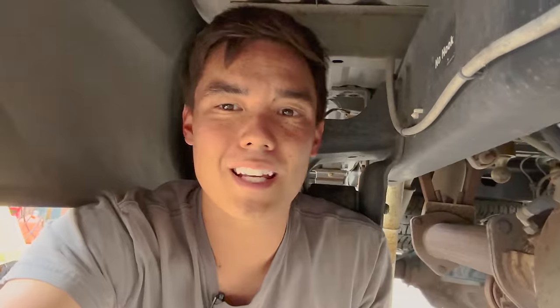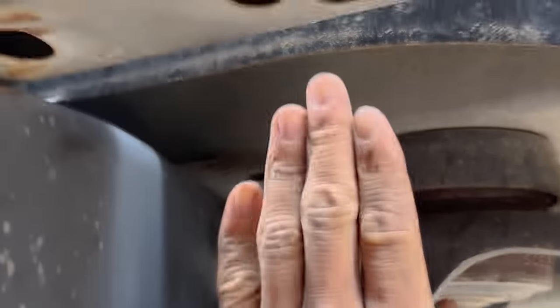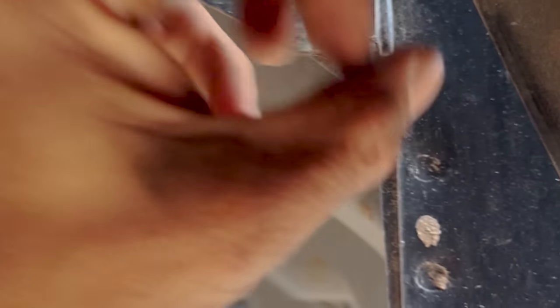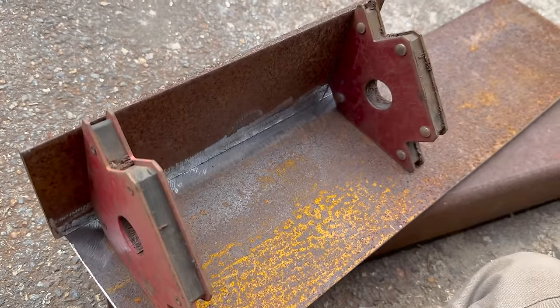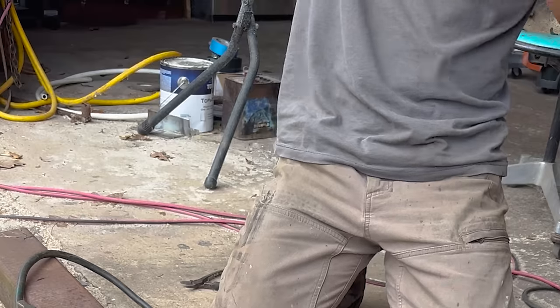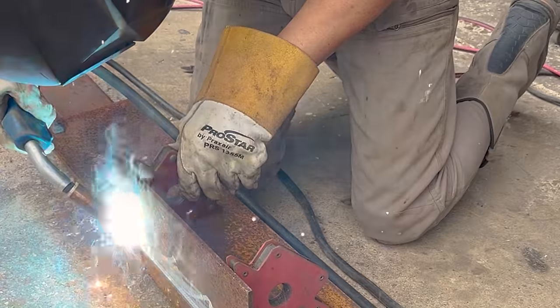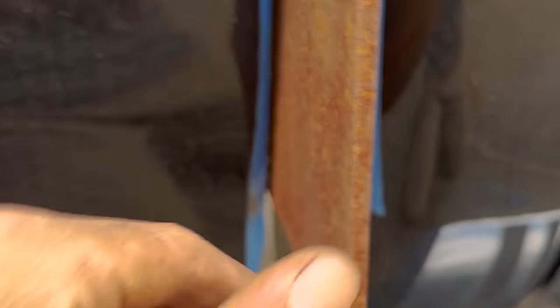Now we're under the truck because the next thing I need to build is tie-downs to hold the camper in the truck, and I'm too cheap to spend like a thousand dollars, so I'm going to build my own. Got some plates — I have a plate here, another plate here, weld them here, they stick out, then drill a hole and run a turnbuckle from that to the camper. Hopefully I can get a bead on both sides. The welding helmet was not on — oh god, I can't see. Almost forgot to turn it on again. This plate will stick out, I'll do some fancy stuff with this, paint it, put a hole in it, run a turnbuckle from here to the camper.